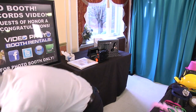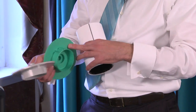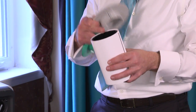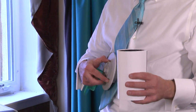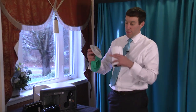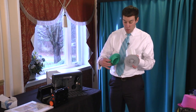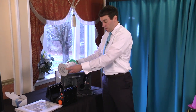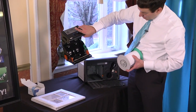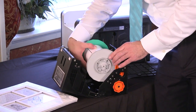I'm going to go into this black bin here — this is the paper roll. The green and gray should already be attached to the paper roll. You'll find this inside the black bin where you find all the wires, keyboard, mouse, and markers. But if it comes apart, there's only one way to put it back. This has two notches on this side, and the other has two and one for three. Look and you'll see the grooves. Now we put this into the printer — there's green and gray in there, and you just match those up. They slide right in.